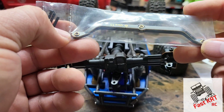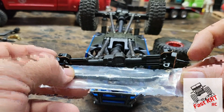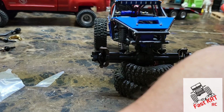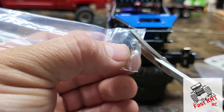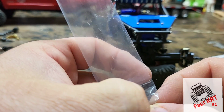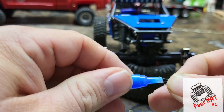So next we'll go to our steering linkage. The bolts are in this one. Same thing, we're going to have to thread lock it. Put it up on here, and get this turned around. Trying to be pretty detailed here because I did not see any reviews on this. I've seen people asking online about this kit, but haven't seen anybody actually do a review or build yet.